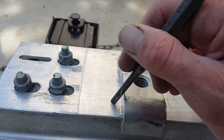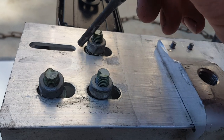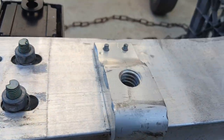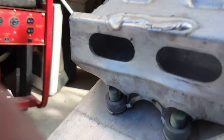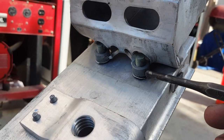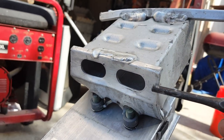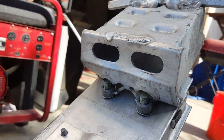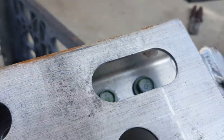These three little bolts — actually pressing rivets — I have a piece on the other side that's part of the actual frame of the vehicle. This vehicle was in a minor collision and this entire piece just completely fell off — it was not held on at all. These are riveted or threaded inserts that go inside, and this is welded to the subframe of the vehicle. As you can see, the welds failed.